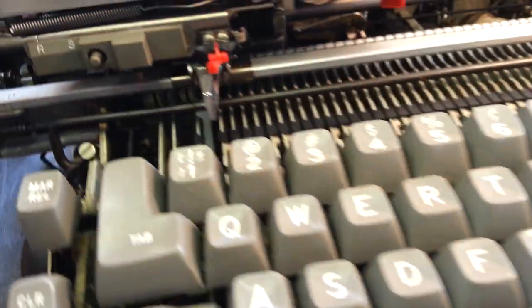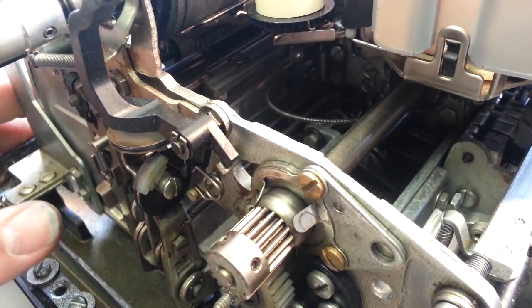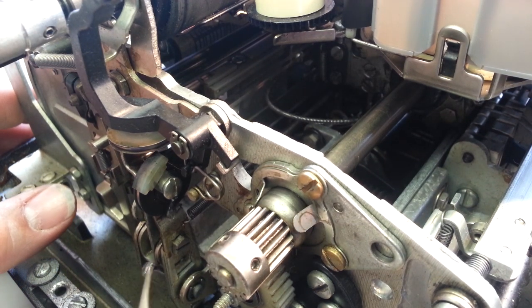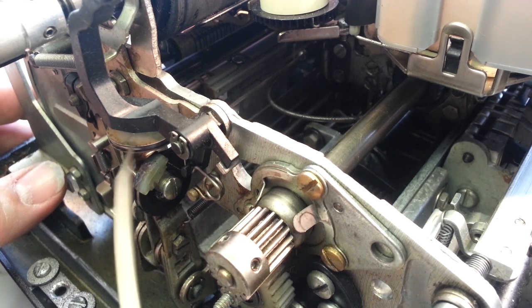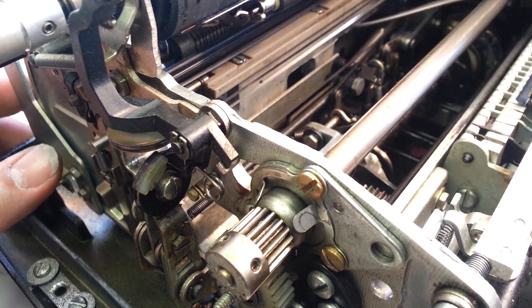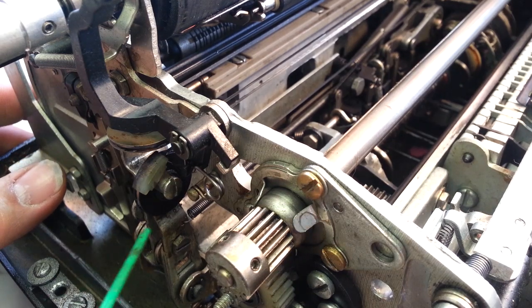Any kind of resistance there will potentially cause the ball not to rotate at speed. So here are the other two pulleys. I'm going to do the same thing on this side. I'm going to flush that one out and flush that one out. Run the shift here, let it spin through there real good. Do the tilt, let that run over. Air blow them off. Repeat.